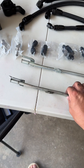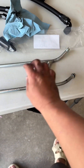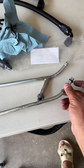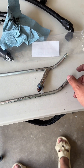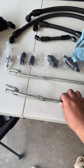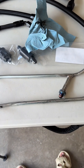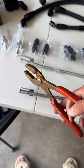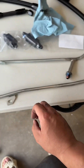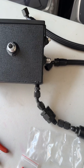Removed the stock oil dipstick, about to replace it with the new one from BoostLogic. You can just take the gasket from the old one and put it on this one. I think this is the hardest part — this thing was not easy. What I found easier: grab some pliers, pinch it up off the top, pull and wiggle, and it pops right off. Don't try to do it by hand.